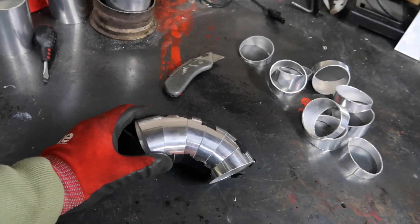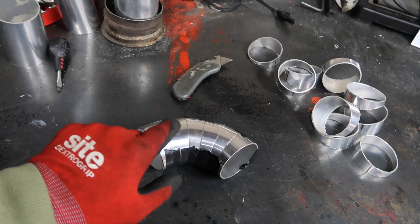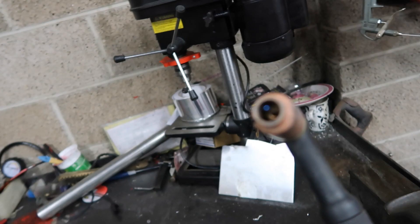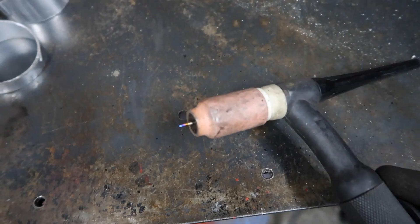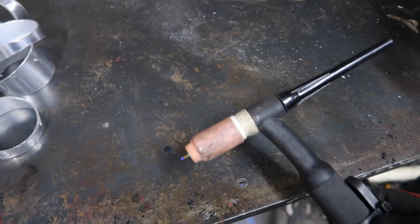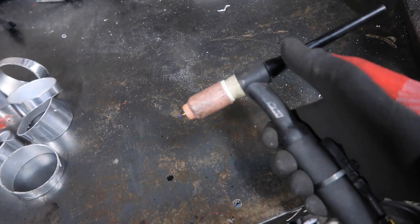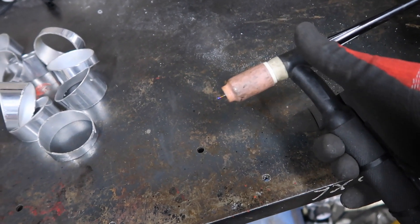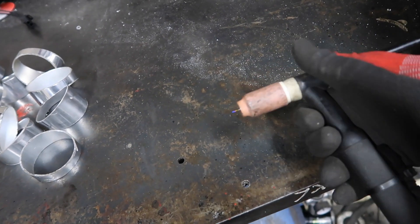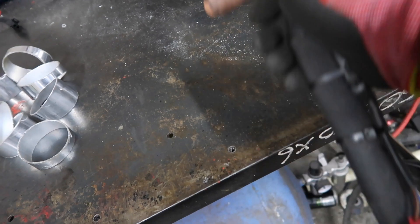There we go — some pie pieces. I just trim the insides with a Stanley knife. Yeah, I know — health and safety hazard and all that, but it works. These are all different sized pieces because I cut them by hand. They should be pretty much 11.5 to 12 degrees each, whether or not I don't know, because that tool's not exactly the most accurate. I'm going to use this as a practice piece, tack a few here, and I'm going to set up the TIG. I normally use a 2.4 mil tungsten, 2% lanthanated, WP27 torch.